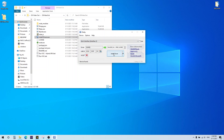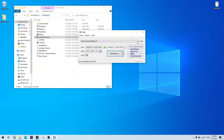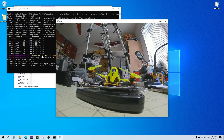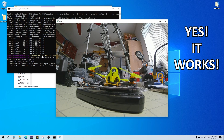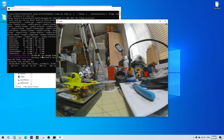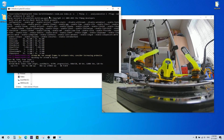It'll install and take a little bit of time — about a minute to five minutes depending on how fast your computer is. Once that's done, you'll have the proper drivers. Go ahead and run the batch program — it's called RunVOC or RunVOC Hybrid GPU. If you have a PC with both an integrated and a dedicated graphics card, run the hybrid program. If you only have one graphics card, just run RunVOC.bat. It will launch a command prompt window with data, and then a window called Pipe with the video out from the goggles.